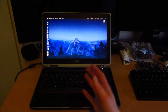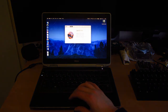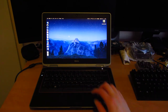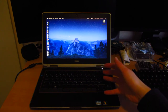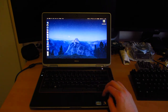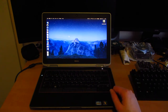So yeah, I might actually have to get another Intel Mac just to create macOS installers for myself. Because the way I prepped this laptop, or the stick for this laptop, is by using a virtual machine that I had on my server. I connected to the server that was connected to it, which my micro server, by the way, was connected to the ESXi host, which is a DL380 G7. I connected to it using VMware Workstation, so I could pass through a USB stick. That's the easier way to do it. Passing it through in ESXi can be a bit cumbersome and requires a full reset of the host, which takes about 20 minutes sometimes.